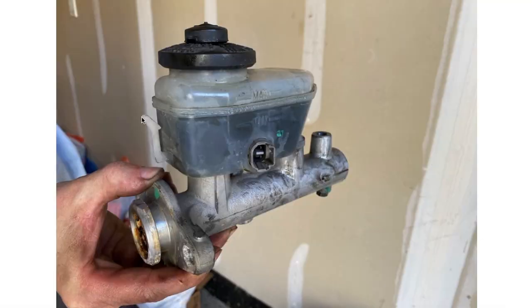DIYers, check this out — we're on the computer right now. I wanted to show you an image of the master brake cylinder that is not installed on a vehicle prior to going outside. This portion right here, the master cylinder, is what feeds into your brake booster. The brake booster has an internal pin that pushes the internal cylinder in and out, and you should have a dust gasket here, held on by two bolts — one on this side, one on the opposite side.